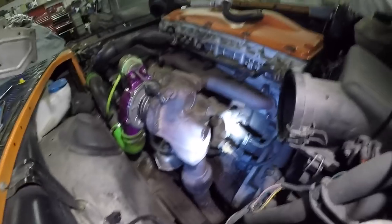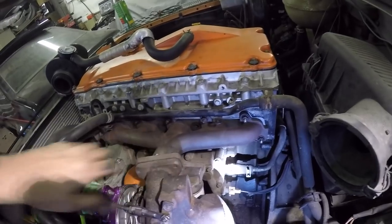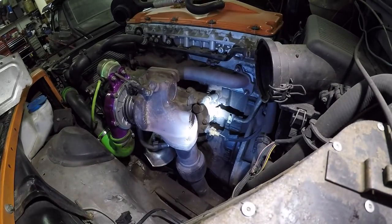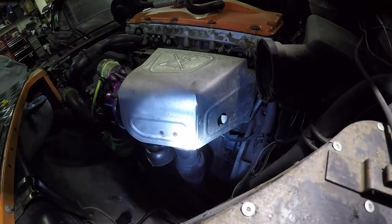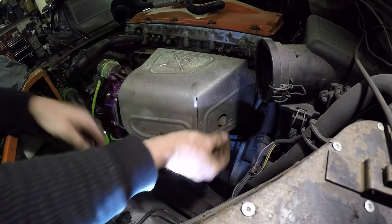So everything's done virtually there. Got the hybrid turbo arm all bolted up. Exhaust manifolds all nice and flat now with the extra studs in. And like I say, it's been modified, so there's less chance of it warping. So that's all good. So just pop the heat shield back over. The two 8 millis, and the top. You got this one which goes down there.